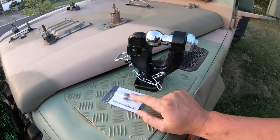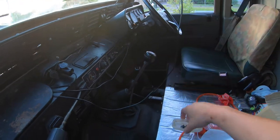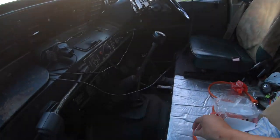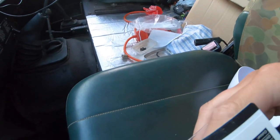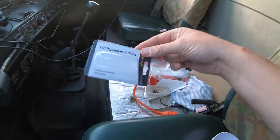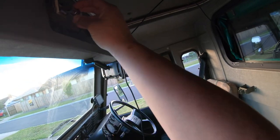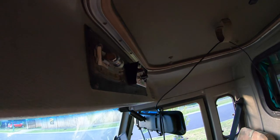We're going to start with the interior light. I've already removed the glass cover and the little chrome shroud - I'll take them inside and clean them up before putting them back on. Now, if there's one thing I'm good at, it's leaving interior lights on, so that's why I've taken the time to get this LED unit. This is a JKR unit, a Response brand, CAN bus compatible - I'm pretty sure that just means they put a resistor in there, which could ironically increase power usage. We'll rotate it in and twist.